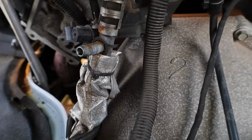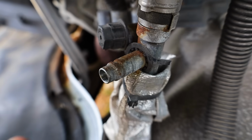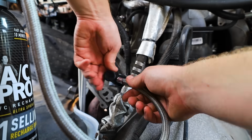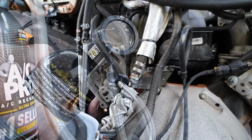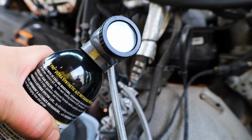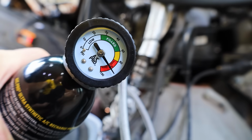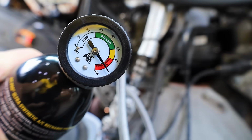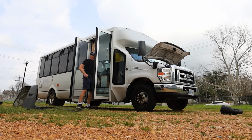And now, the moment of truth. Because we found our low pressure fill. And we're gonna see if there's any coolant in the system. Good. It says overfill by a long shot. Well, that's what it should read if it's full. That's a good sign. It's an electrical issue. The compressor's not getting turned on. So either we gotta start checking fuses.